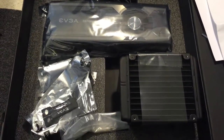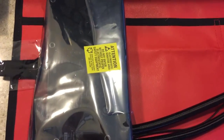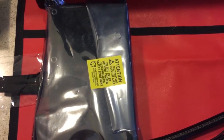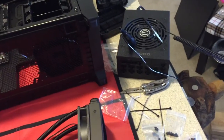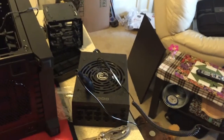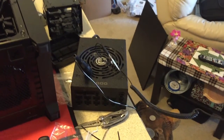Cool, so I'll be installing this next. I was looking at this bag and it reminded me that it says do not enter without proper electrostatic safety equipment. So I am using a grounded mat right here that the case is sitting on. It's plugged into a clip that's clipped to this power supply — I'm clipped into the power supply too. Power supply is not powered on. Please be careful if you do this, but it is plugged in and grounded.